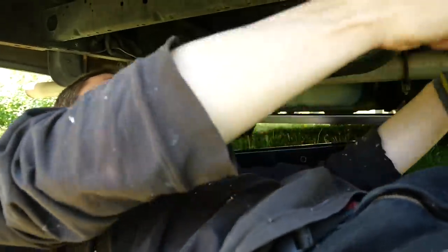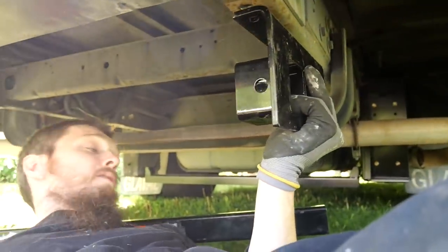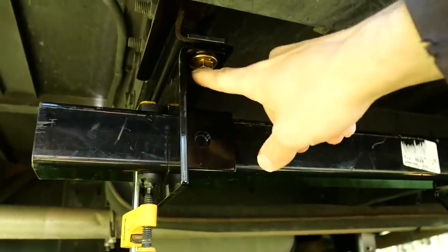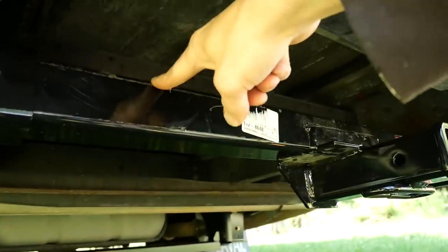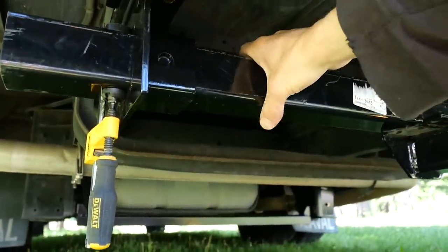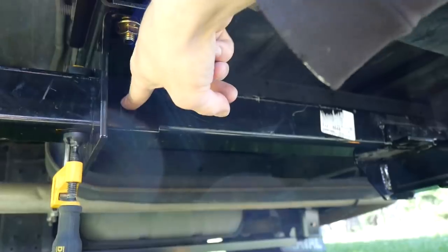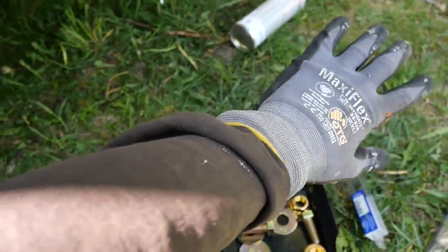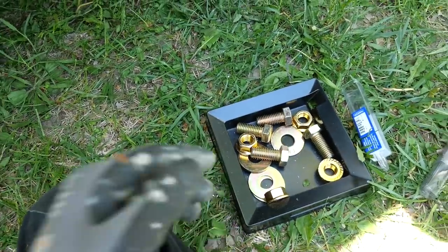I need a magnet. Why did I lay underneath it? Maybe I'll try to use this and just see if it'll hold the drill bit still. We got these brackets bolted on — just hand tight — slid the hitch back through it and centered it up, clamped the ends so it can't move, and now I'm going to be drilling these out right here, through the bracket, through the bar, on both sides. I'm more protected this time — I tucked my sleeves into my gloves because now I have burns all over my arms, and I'll keep my belly out from under it.